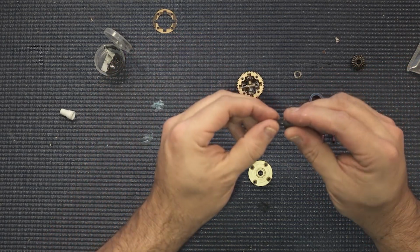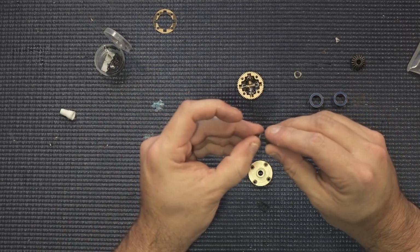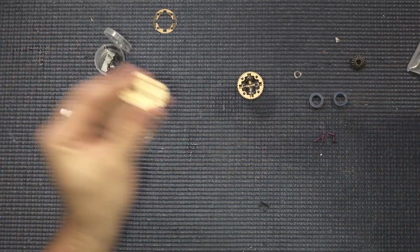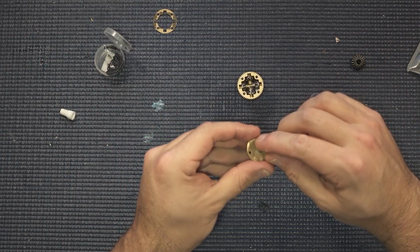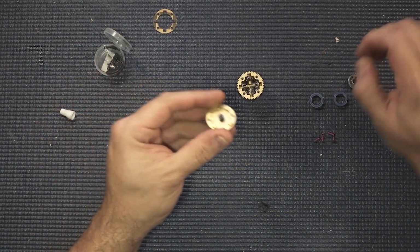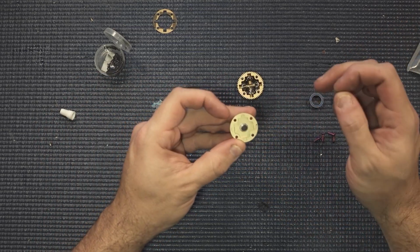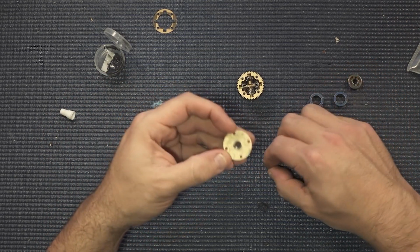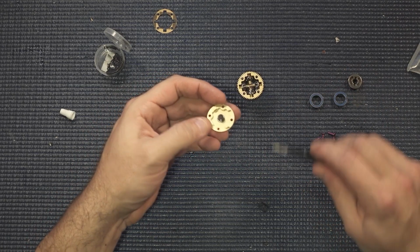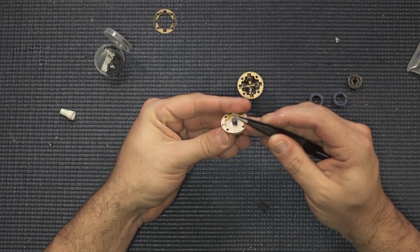and grab ourselves an O-ring. And then we're going to go ahead and put that on there, pop that through, and then we will have a washer that goes on top of there. And then there should be another outdrive pin right here. And this top one is pretty much the same. We can see that we don't have a lip on this side. So we'll grab our tweezers, and this should stick very well. Should have some diff fluid on it. And we'll spin it around here so we can actually see the hole.